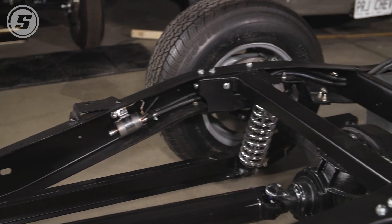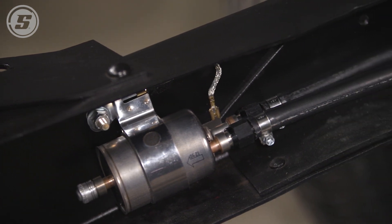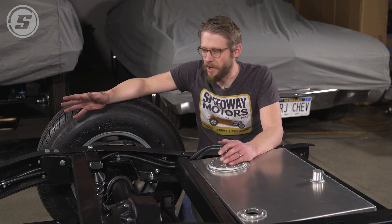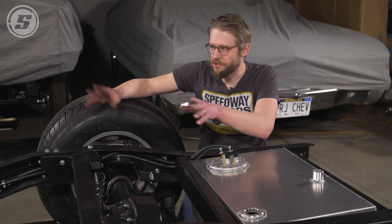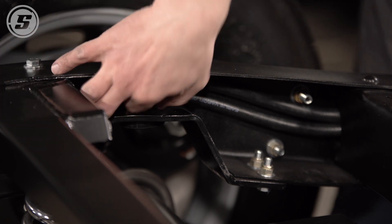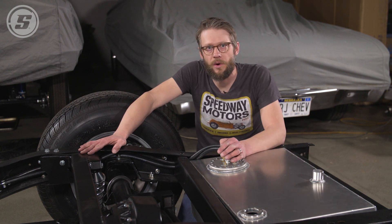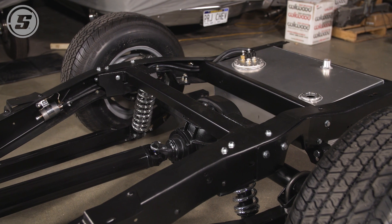That pretty much does it for the main components of our fuel system here. We've got our underbed tank, our in-tank pump, and our filter and regulator. For anything with more power than we're making, we might want to do some more trick pieces, but this is the most straightforward way to get there with a 430 horsepower engine. We've still got one line to run from the filter all the way to the fuel rail, and we want to get our cab on and exhaust routed before we finalize that. We also still have to add our fuel level sender once we know what gauge we're running, and our through-the-bed-floor filler will install when we put the bed on. If you have any questions about your own fuel system, feel free to let us know — and thanks for watching.